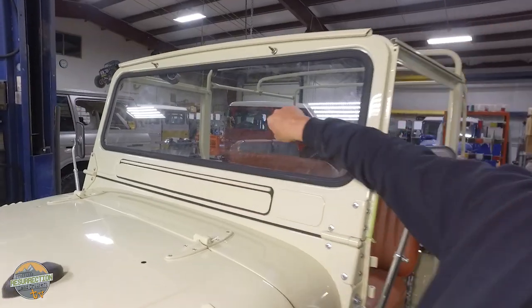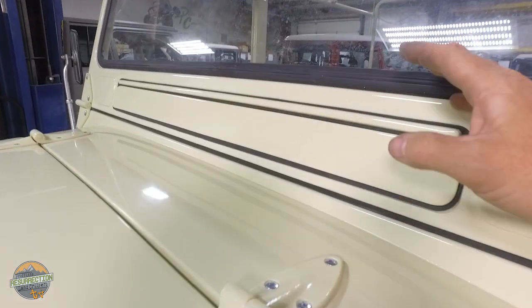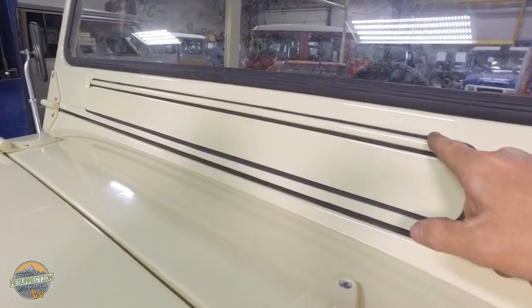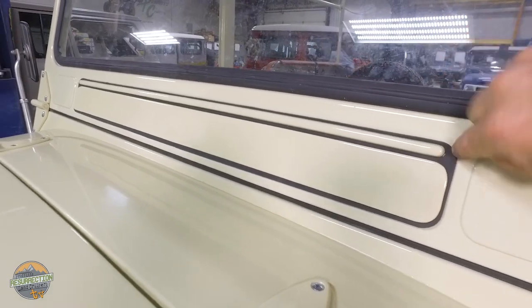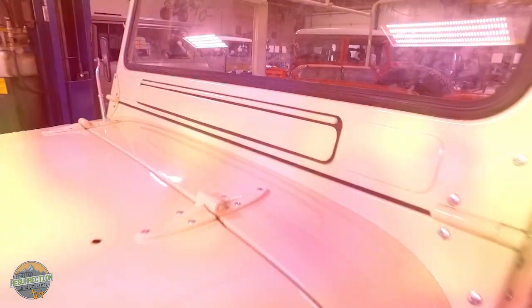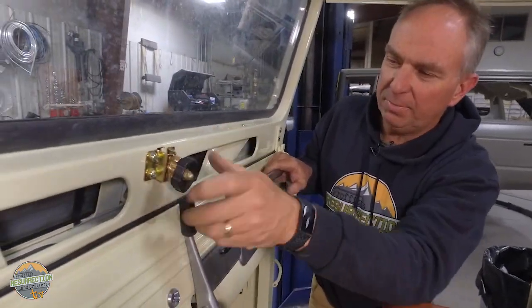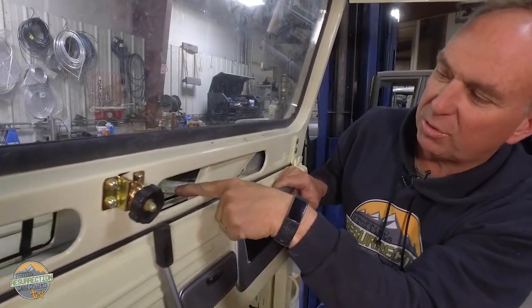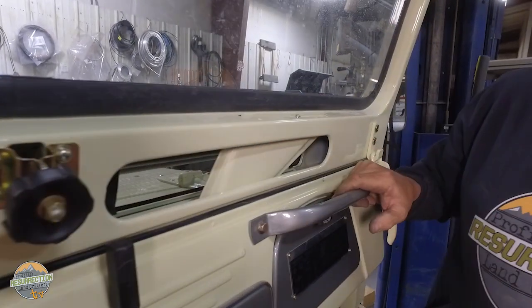So you can see on this replacement windshield frame, which we've installed, by the way, because the old one didn't have provisions for defrost, that we painted all of the vent pieces separately. There's a new rubber gasket there that acts as the hinge for that. Then on the inside, we did just what they should have done. We've gone ahead and re-zinced the mechanism for the vent. You can see that the screens and the clips for the screens were individually powder coated black, so they look better.